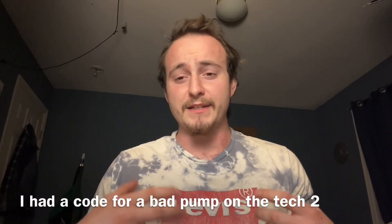Why am I doing this? In stock right now, they don't have the proper BorgWarner pumps. I tried a bunch of aftermarket pumps and none of them worked. Only genuine ACDelco pumps and the BorgWarner aftermarket pumps — both of which you buy on eBay or eEuro parts — are the only two proper replacements. My pump was dying and I tried all the other aftermarket options that were less than $200 and ended up having to return everything because none of them worked. They were all for systems with higher amperage — other models of Haldex 4.